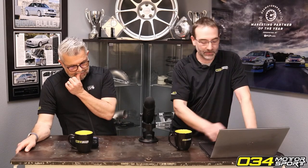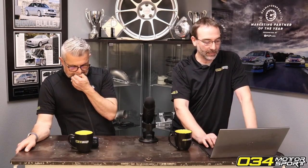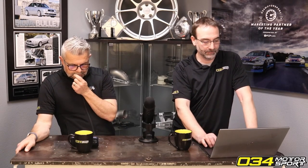So all of our calibrations are done on E80, as that's what's generally at pretty much all the pumps around here. So no, E80 is actually, you're right in the sweet spot of where the calibrations are fully developed. And I'm assuming you're running the E85 file. So yeah, we give a range of E60 to E85 for those files. So you're doing just fine there. I don't know why they would say that. It could be unsafe if it's not calibrated for that ethanol content.